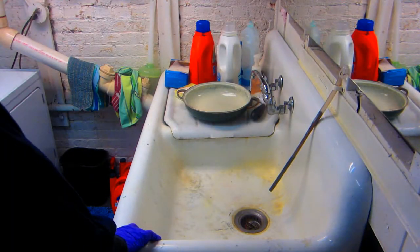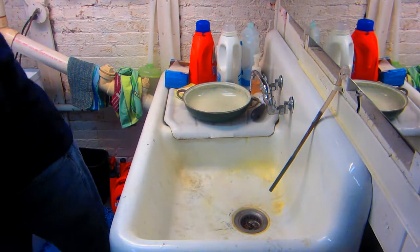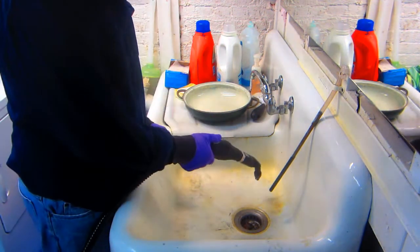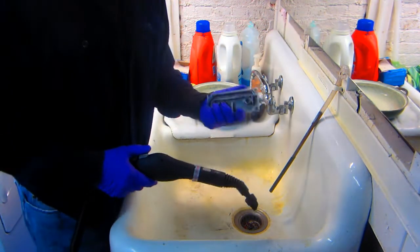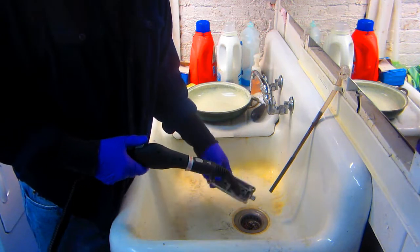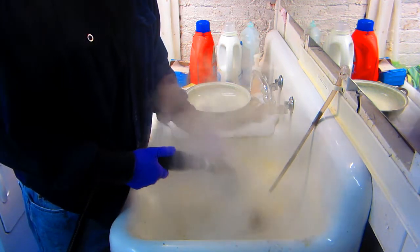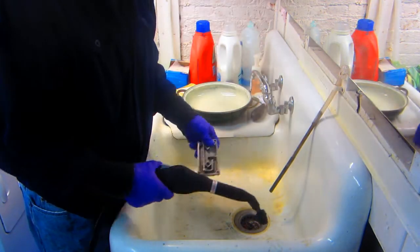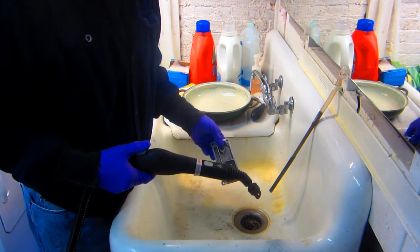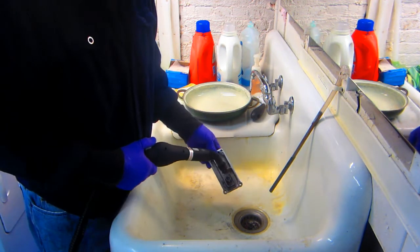Now this steam cleaner has proven to be so good in so many ways, and I've found several good ways to use it: cleaning the car, cleaning wheels, but it's really good for cleaning parts. Now these parts still have the fingerprints and things that might have grinding compound on them. So for sure, I see stuff jumping out of here already, because number one, it's 200 degrees, a little over 200, and it's under tremendous pressure.